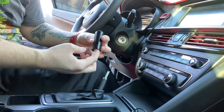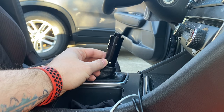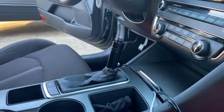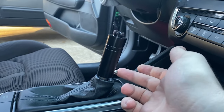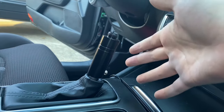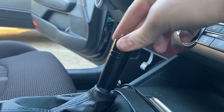Go ahead and put the screw in and get that attached. You may also want to think about where this set screw is going to be visible when you're done with the install — I'm going to point mine facing forward so I'm not able to see it. After tightening the set screw all the way in, I noticed a problem: when it goes all the way into the hole on the adapter it allows the adapter to spin left and right freely, which I definitely don't want. So I went ahead and got a little bolt with a regular screw head to hold those sides in — it's nice and sturdy now.